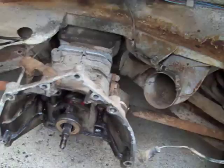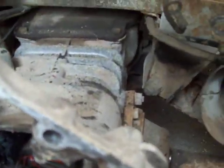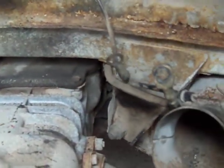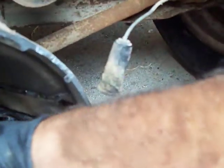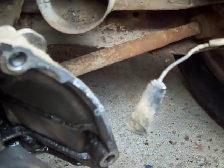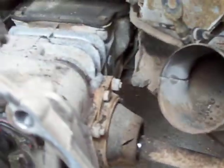The transmission I think is a crash box — pretty much what it looks like. I'll pull that out of there, just a couple of bolts, and pull that inspection cover off the top to take a look and see what condition it's in. With 44,000 miles it might be okay. There's no leaks on it, though it's going to need some axle boots.